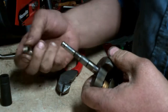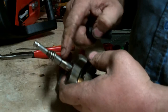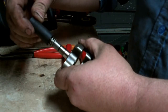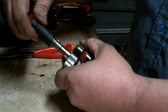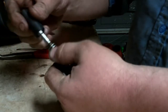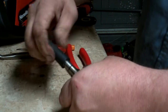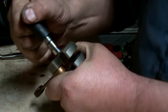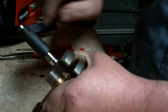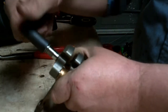Once you get the new one, just stick it on the crank and let it kind of dangle. You'll see this groove right here — that's where that first little coil goes. Take the tool, thread it over the gear until it stops, then push it. It will stop once you feel it click into that groove. Just unscrew the tool and the spacing will be perfect.